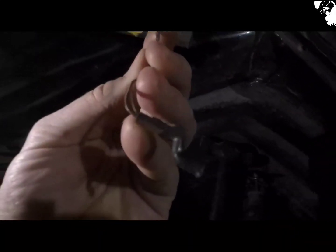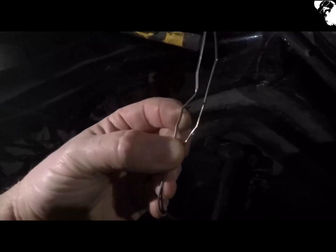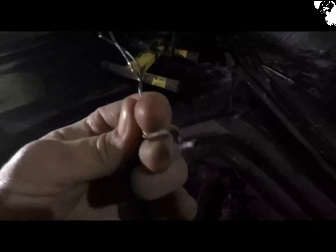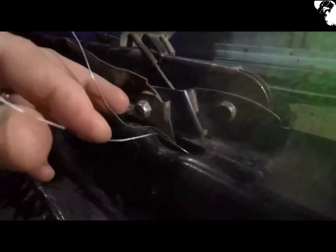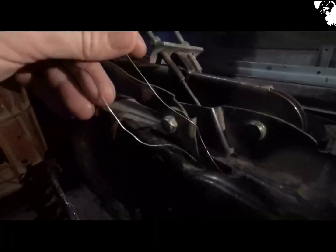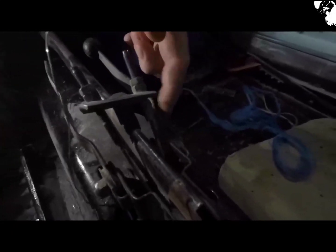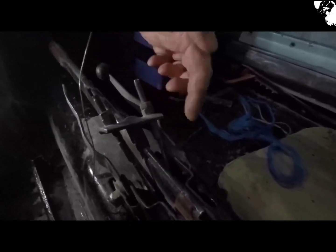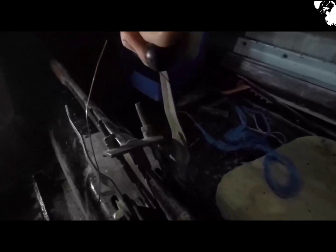This cable I've just removed from the left-hand side control lever — it's got two wires attached to it and that operates the flaps on either side of the tunnel underneath the rear seat. You can see these are the two wires I've poked through from the rear, going up to that lever there. The cable connected to the right-hand side also has two cables spurring off of it, and that controls both the control flaps at the heat exchanger end.